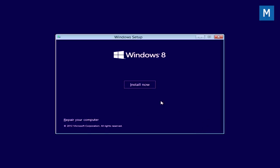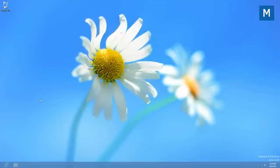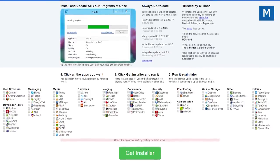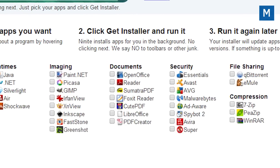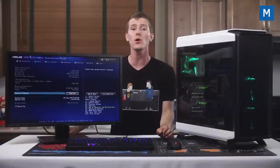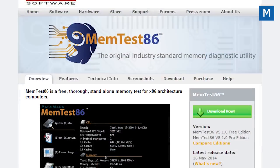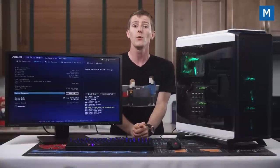Create a bootable USB drive using our earlier guide, then reboot while mashing F8 to get into the boot device selection menu and pick your USB drive. Once Windows setup begins, it's basically a matter of clicking next until you reach the desktop. At the desktop, grab the latest drivers from manufacturer websites rather than the discs in the boxes, then hit up ninite.com for your essential free software — choose antivirus, alternative browsers, system utilities — and it installs them all without bloatware. Run Aida64, Memtest86, and Prime95, plus some good old-fashioned gaming to ensure everything is working correctly.